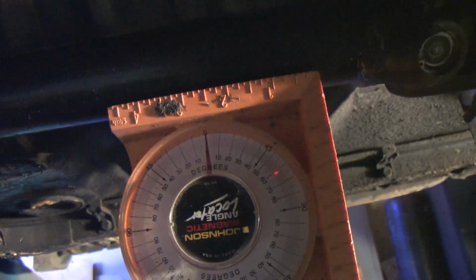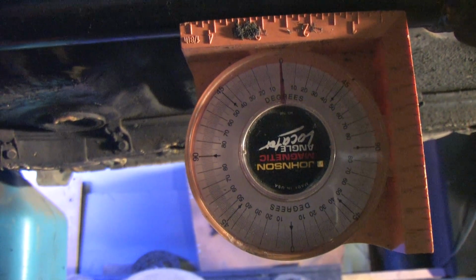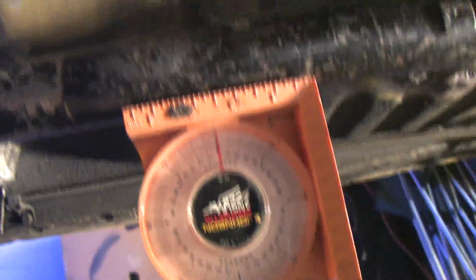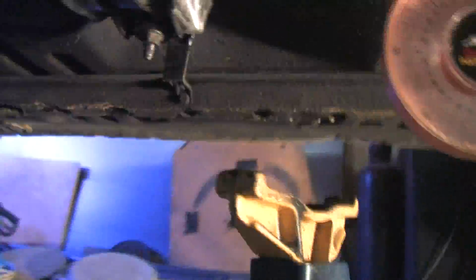All the documentation I've read assumes you're working on a car that's already got factory mounts in the right locations. I'm not finding pinion angles in the service manual anywhere. Google and tuners are coming up short for me. I know that in rear-wheel drive drag setups, 2 to 3 degrees is usually a sweet spot for a one-piece driveshaft, but that factory cars sometimes come with 1 to 2 degrees.